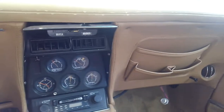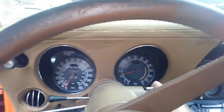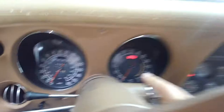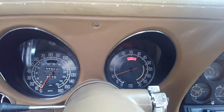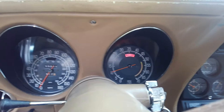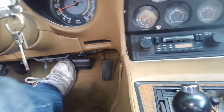I'm going to show you guys what happened when we pulled this one out. I've had it in storage probably the last year. As I went to start it and brought it home, you can see the brake light staying on. Sometimes that could just be an issue, but that tells us we've got low brake pressure somewhere in the system. You can see the pedal going all the way down — we've got almost no braking power whatsoever.